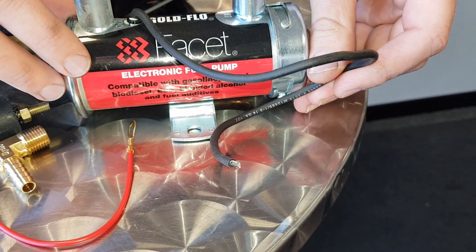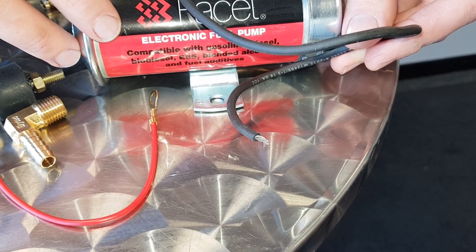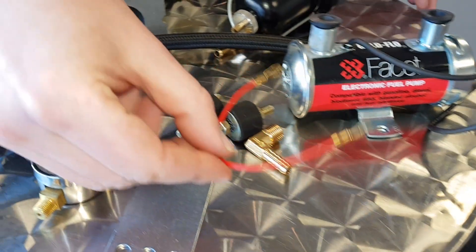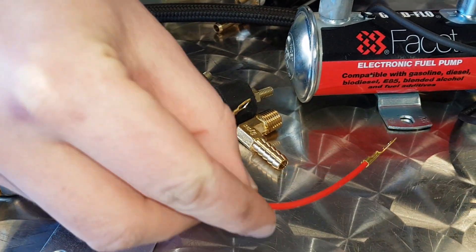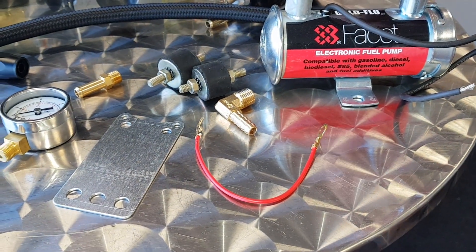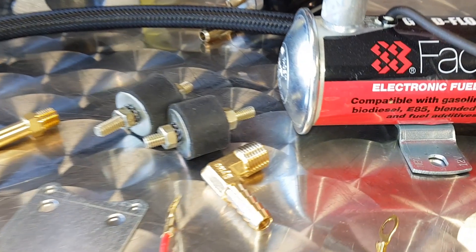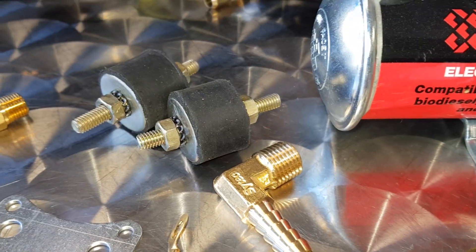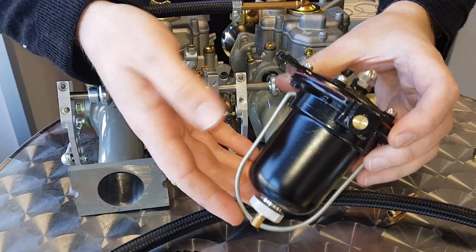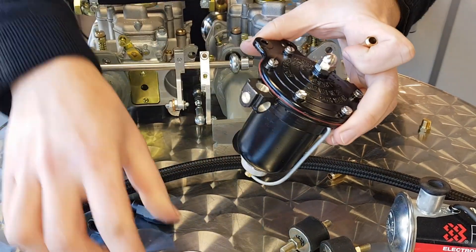So for competition usage this is the one to go for. There's just one power connection — quite a big chunky cable but they only draw just under 2 amps, so no need to run a relay on that — and then you've got the earth cable. In some race cars they run it without the bobbins, but if you're running it on the road you really want to be using them. It comes with the same motorsport pressure regulator, this time with 8mm tails and again with the optional pressure gauge.